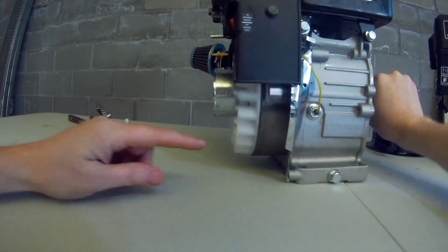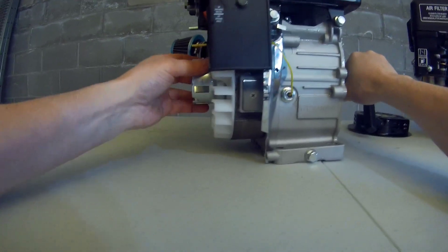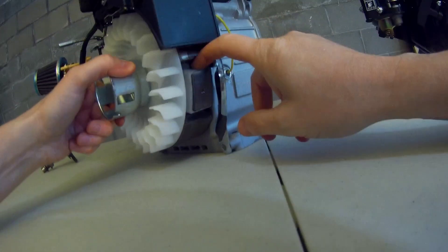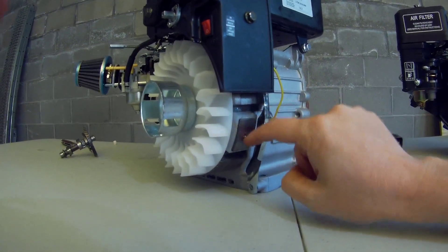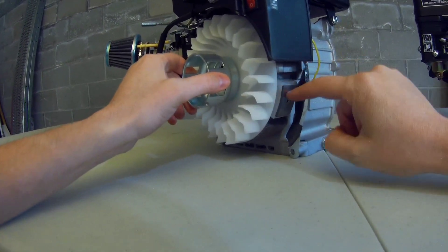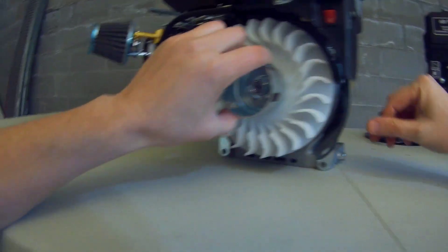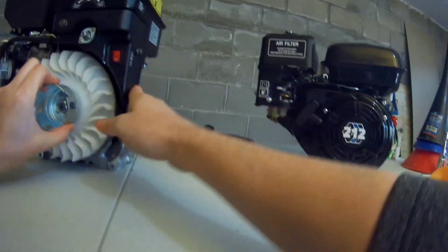As you can see, this part turns as well. This magnet over here is not really desirable if you have higher RPMs. Some of them are bolted on. This one may be a little bit of a composition of glue — looks like we've got some glue on here and a screw. At very high RPMs, these are spinning so fast and they're far away from the center that they can actually fly off of the engine, damaging everything around it. So you've got to be careful with race engines.